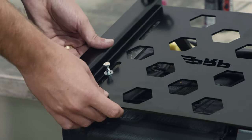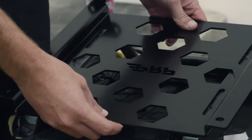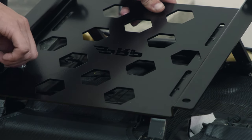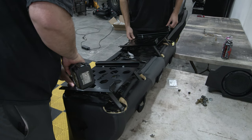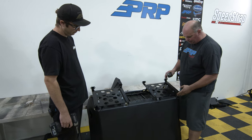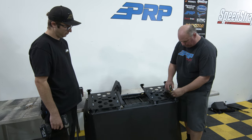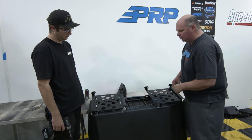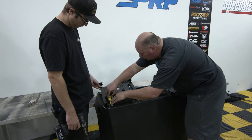One thing you want to consider is the placement. Now that I have this one loosely tightened, I want to make sure the other side is completely lined up and matches. You only have to configure it this way when doing the bench, so it sits properly when mounting it to the actual car. Before tightening this side down, make sure it's even so that the seat doesn't sit in the vehicle sideways. We're going to measure from the back of the slot to the center of this bolt head — we have exactly one inch, which will keep this off the firewall of the vehicle.